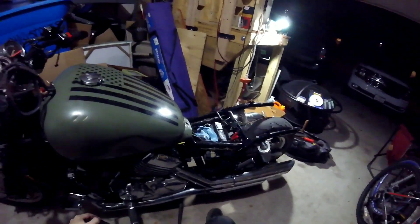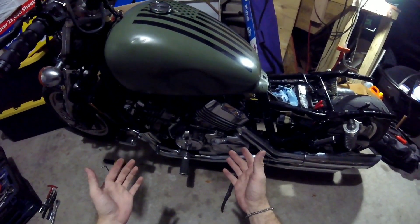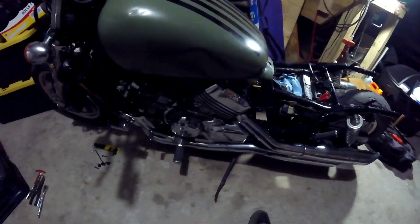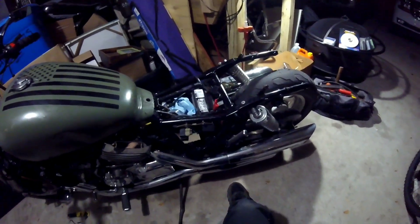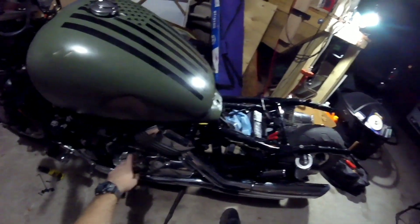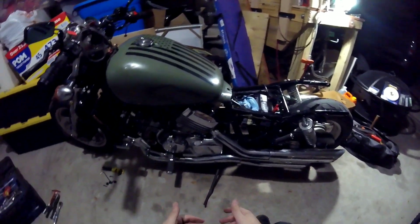Alright, that's going to be it for that. At least we know the gaps on the plugs are to spec now. The next step — I really don't know if I have to check the wires, because they're brand new and I've already inspected them; the wires look great. The coils look good, I've already ohmed them out and they're providing spark to both sides. So I think it's very possible the next step is going to be these boxes here.